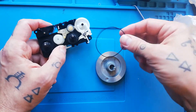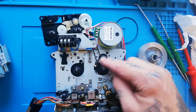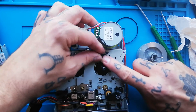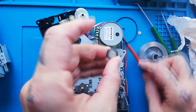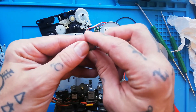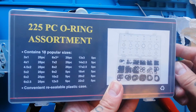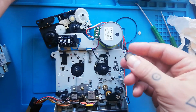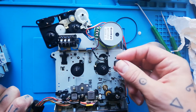The first thing to do is make sure that belt is okay. Also check that the idler tire is in good condition — that's pretty easy to remove. You can just get a flat-head screwdriver under there; a little white plastic pin comes out and the tire will lift out. In this case I've got a circular cross-section O-ring in there. I found that a 6 by 2.5mm size just about works. If you can get the right size with a square cross-section, I would advise you to do that.